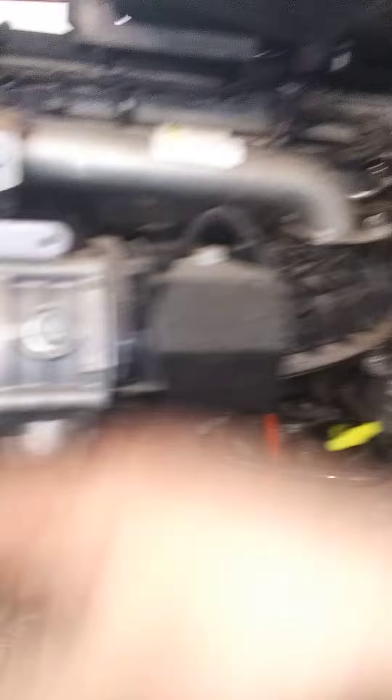What I do is drain the fluid — drain your oil. In this particular engine, you've got your oil filter up here, but a lot of times you're going to have it between the frame, usually on the passenger side. On this one the fuel filters are right here, but most of the time you'll have them up on the driver's side. We'll later work on how to take filters off on Caterpillar, Detroit, and Cummins engines.